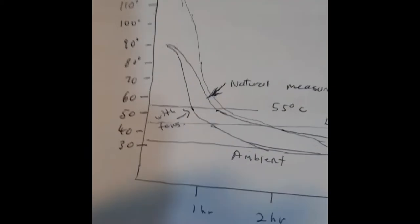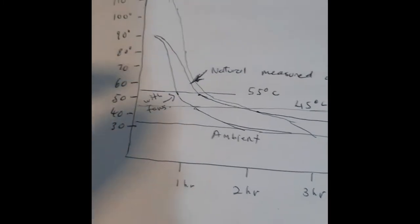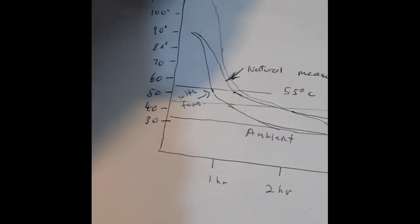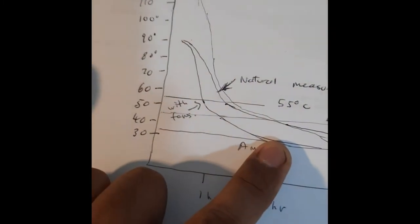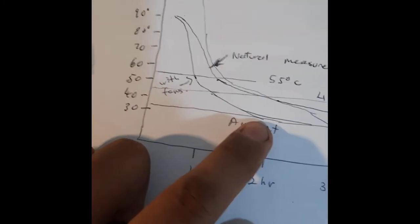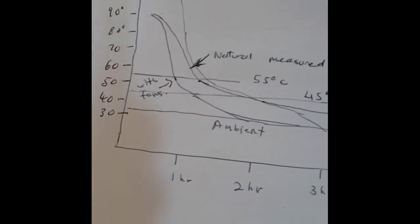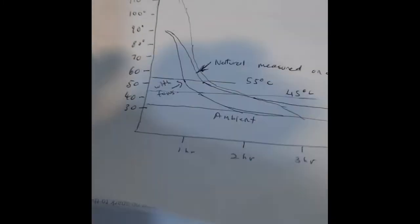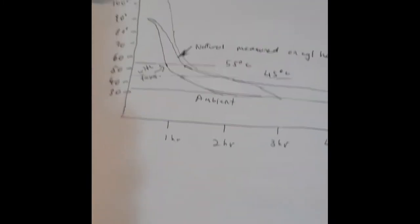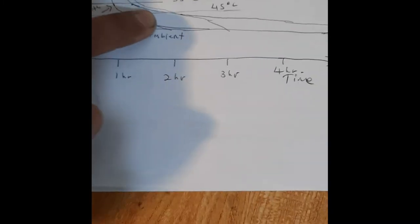So I have no choice but to find somewhere else to measure the temperature from. Anyway, even if I put it on the turbo shield, the temperature there actually goes down much more quickly than the cylinder head, so I'm not too worried about the turbo temperature. So I decided to put it right on top of the cylinder head, where the spark plug wires are sitting, since we want the electrical parts and the rubber parts to last longer. So I measured on the cylinder head.